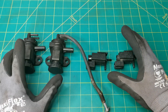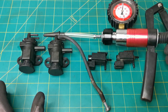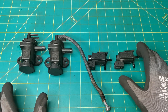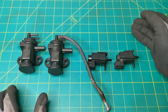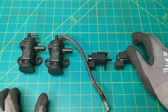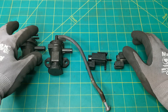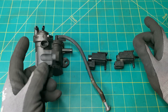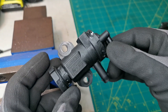We're going to need some components to test these. First of all we need a vacuum gauge to apply vacuum and see what it's capable of holding. You're also going to need a voltage supply — a 12 volt battery, the vehicle's own battery, or something from a jump pack. We'll also need some blanking caps to block off ports while we do the test, and you can do a multimeter test to check the ohms across them as well.